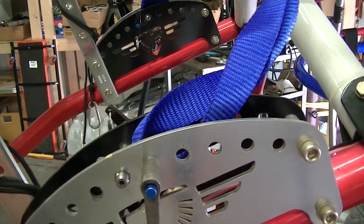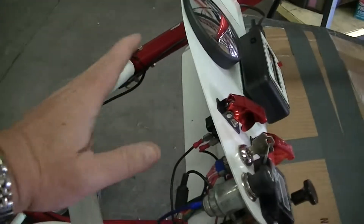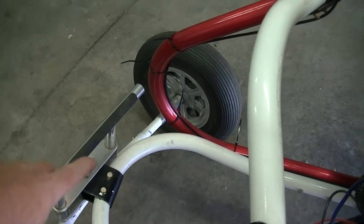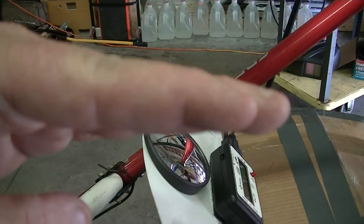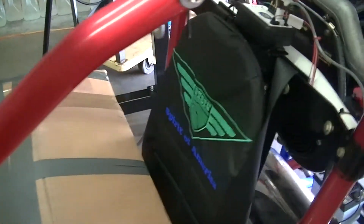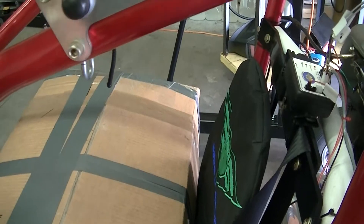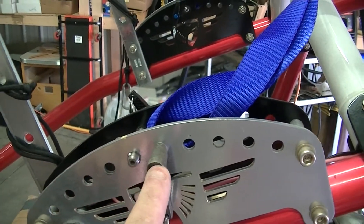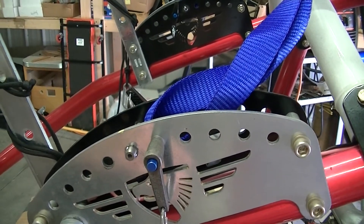You don't need your wing for a center of gravity check. You're going to get inside your Green Eagle and make sure you have anything that you fly with. For example, I have my reserve chute up here. I wear heavy boots, which is going to put weight up front. We're checking for angle — the back is going to be heavier. So you need to be seated inside. You'll lift it up and start checking these pins. This is pin hole number six.